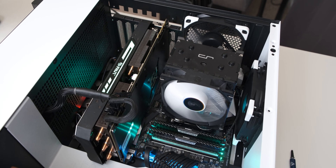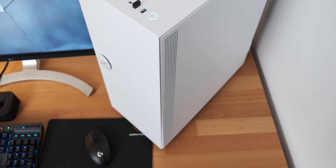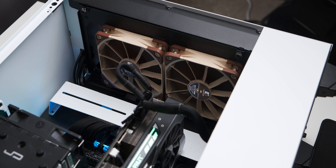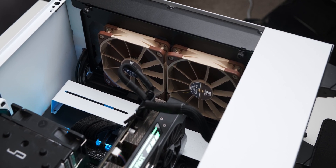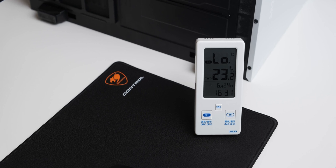I placed the case flat down on its side because I couldn't have it standing up without a screwed-in cooler — I need gravity. But this meant that because of how the NZXT H500 is designed, it actually blocks off all of the intake airflow vents, so I had to take off the side panel so that actual air would come in.